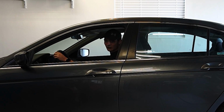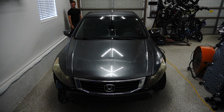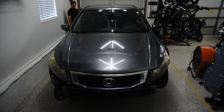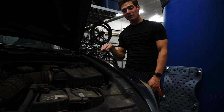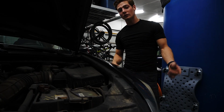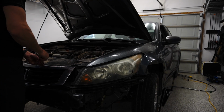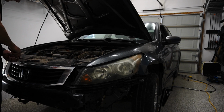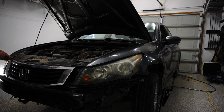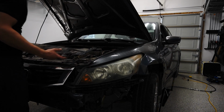That is not a pretty sound. This is where the majority of the damage is. There's some to the frame on the lower side. We have to get this off and the headlight off in order to see the extent of the damage. To get the panels off, first we have to remove all of the trims and covers on the front and on the driver's side of the car. All of them are just held in with these little push clips that slide out.